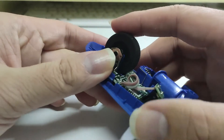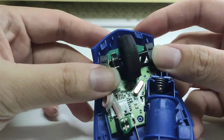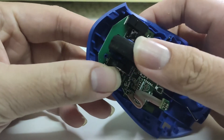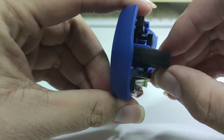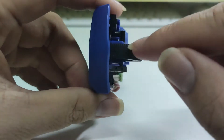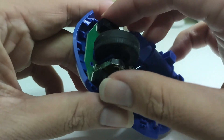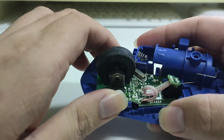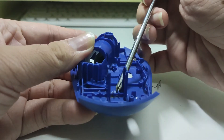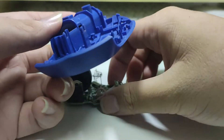After cleaning up and assembling it back, I found that when the circuit board is tightly fit into the body, the scroller becomes a little bit hard to scroll again — there is resistance. There is no contact on the side walls, so something must be rubbing the scroller against the body. Let's remove it again to see where the rubbing comes from. I can see there is a bridge along these two sidewalls holding the scroller, and I suspect this bridge is causing friction against the scroller.